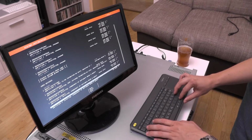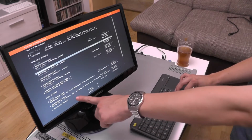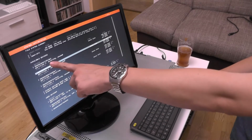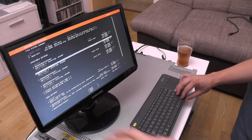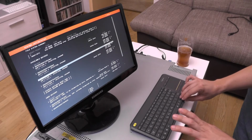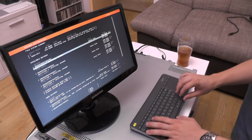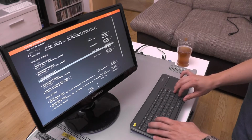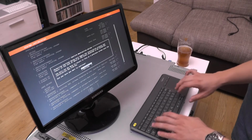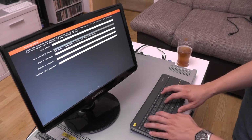Where is the UEFI partition? UEFI partition is on the first disk. It's here, partition 1, on the first disk, because it's the same serial number. Because this is the first drive, and all the others are unused for now, which is fine. That should be it, right? Software RAID is shown as unused, but it shouldn't matter. This should be okay. Done. Continue.